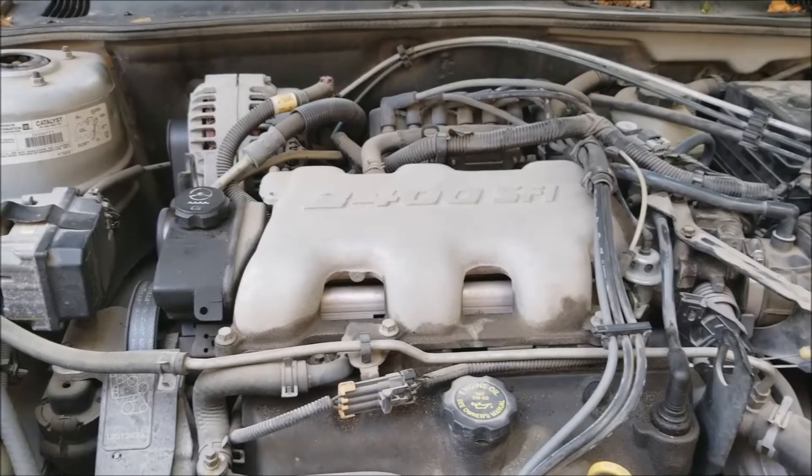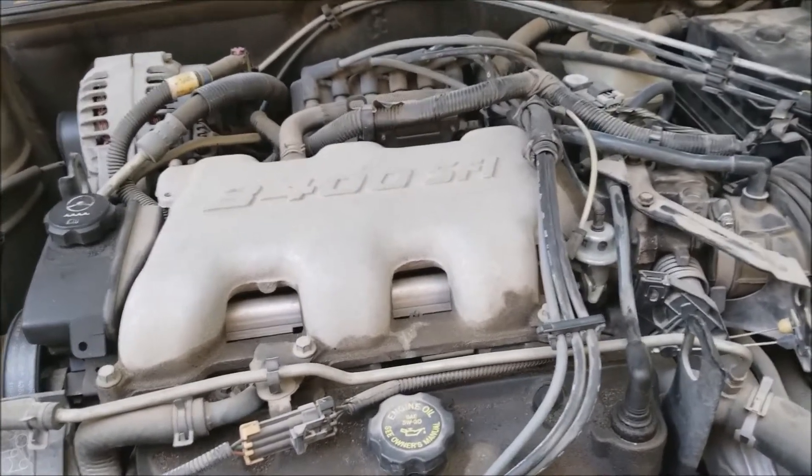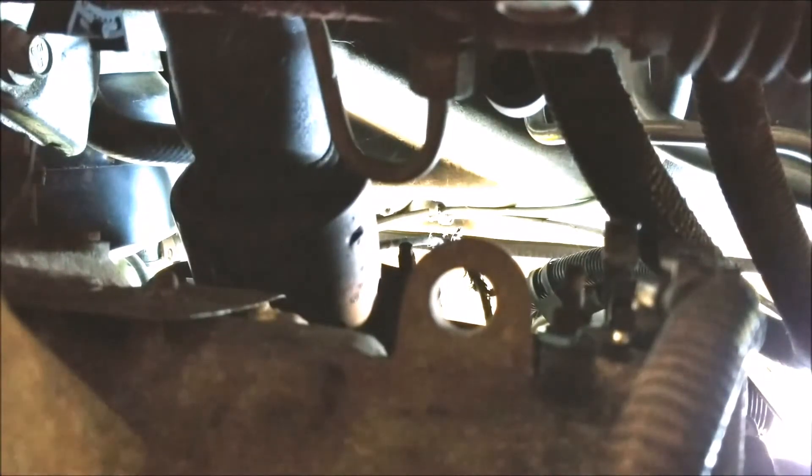Here we are underneath the car. The sensor I was talking about is right here — really close-up video because I have the car lifted about a foot off the ground. I'm going to disconnect the sensor and hook up either a voltmeter or an oscilloscope. How the sensor should function is basically to send pulses — roughly four pulses per revolution of the transmission — and that's what we're looking at. The P0502 code means we're not getting enough pulses for what we'd expect to see.